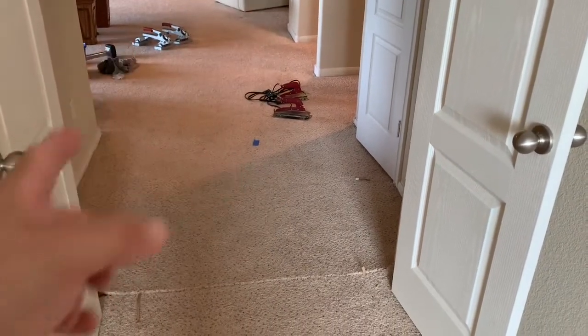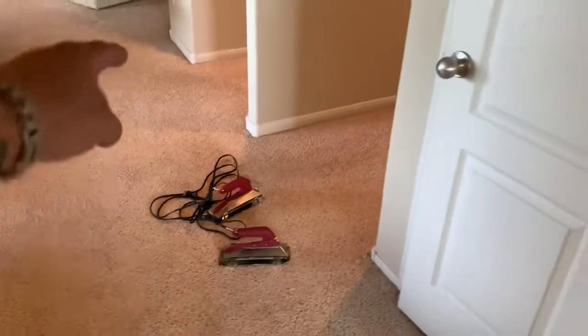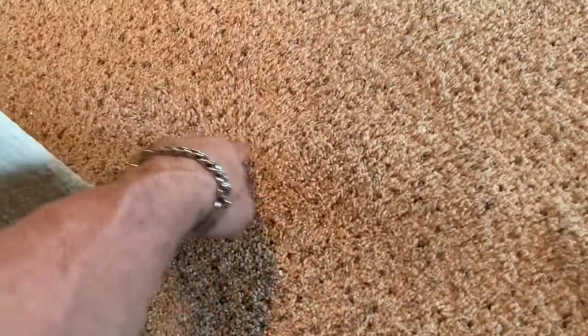I think I'm going to try something tricky over here that I haven't done before to aid in the removal of that wrinkle down there. There are several things you can do here. What I've done in some videos is, if you just can't make a wrinkle go away and you want to fix the aesthetics, you can cut it open and cut a small sliver out. Or sometimes you can cut it open without cutting anything out, put tape all underneath it, and then with irons — if the iron on the top welds it to the tape on the bottom — it'll be rigid, hard, flat, and it won't stick up anymore.